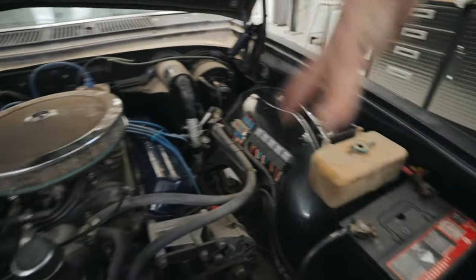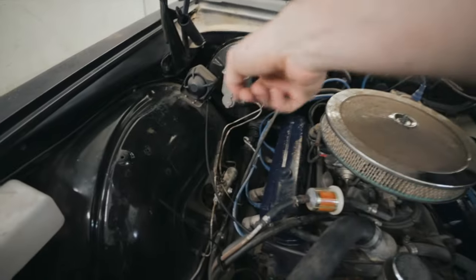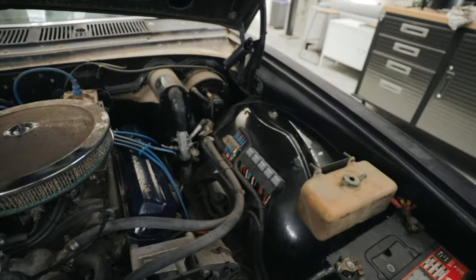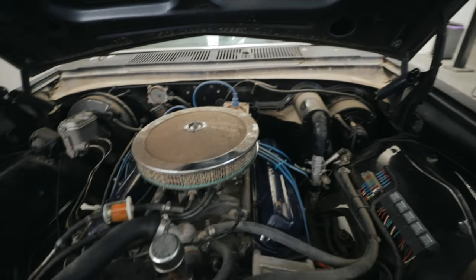engine bay because it's just a mess. You know, these old cars' wires are just everywhere. I remember harnesses down here melting away and everything, so everything's fairly good. It's actually still pretty good. It's just dirty. Got relays, everything's fused, circuits are protected. Headlights, there's all relays on them now. So before they used to just run full load through the switches, which just kills the switches.